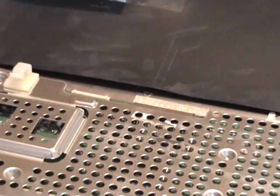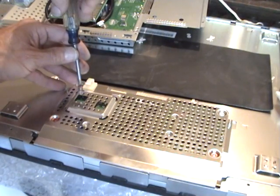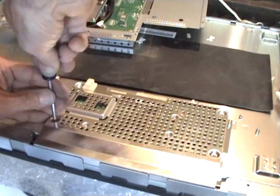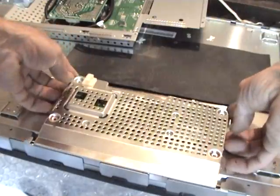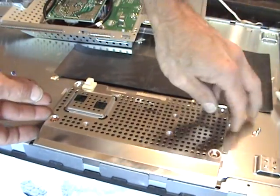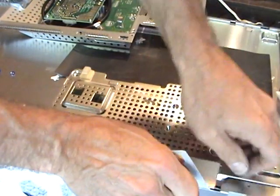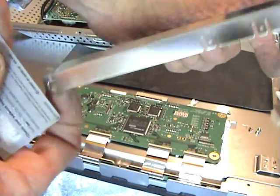Get rid of the tape. Alright, now we got to take care of the little 4 orange screws. Zoom back out. I cut myself, so be careful, that metal's sharp. Take off the 4 screws from here. Then this board will lift up. Alright, and usually you wiggle left to right a little, and it'll pop out. Come on, once you get it lifted up partway. If it doesn't, there's my card. Take the card, get it in between the two, just get it to go. There it goes. And there's a couple little catches on the ends. You grab just enough.